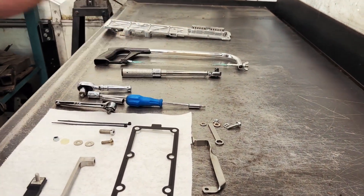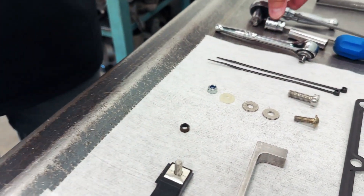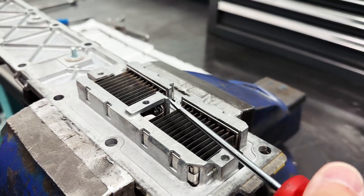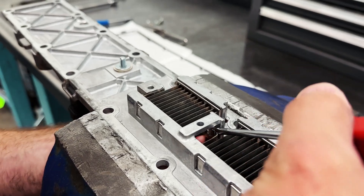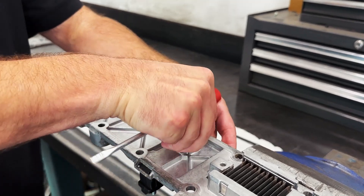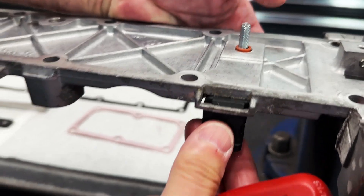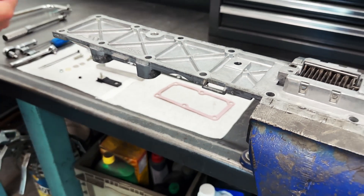There's an insulated washer we'll remove here — careful not to lose all your hardware. We'll need to save this insulated bushing. There's also an insulated washer on the opposite side that goes against the heater element. Pull those out, and lastly, pop the insulated washer off. Then pull out the upper bus bar by forcing it down and out like so.